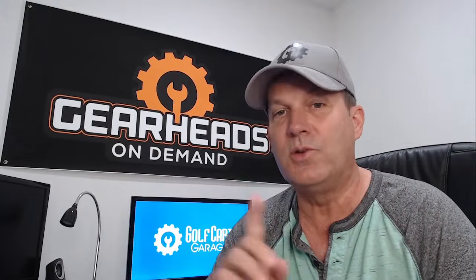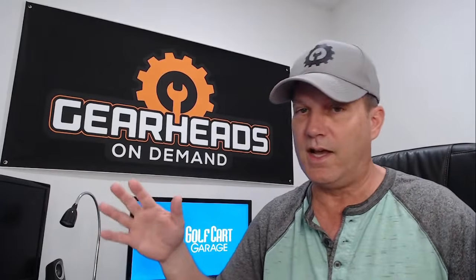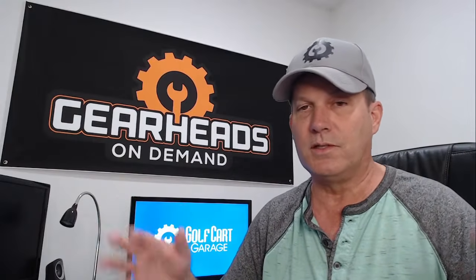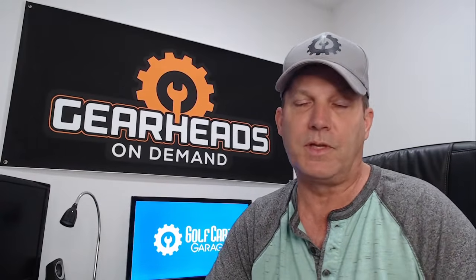Now, other than that, you could have a bad relay. If you find out that the outlet is hot and everything's fine and your battery voltage is high enough, I'm assuming that your battery voltage is high enough, you could have a bad relay. That's a common part that can be replaced in those type chargers. The relay is readily available for that charger.